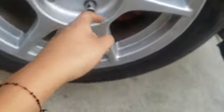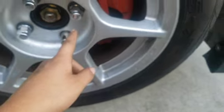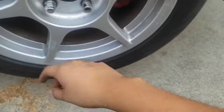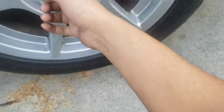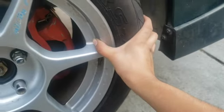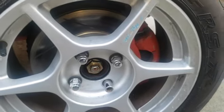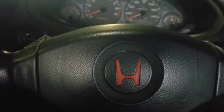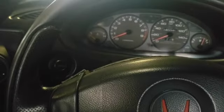The other little problem I found is this wheel is moving. The first two times I drove the car I forgot to put the axle nut back on and never noticed until my cousin pointed it out. I pretty much lost mine, so he let me borrow one, but as you can see there's still play when I'm moving the wheel.